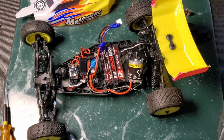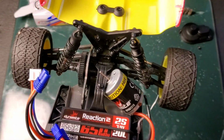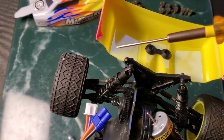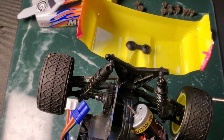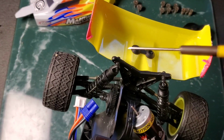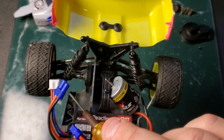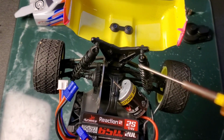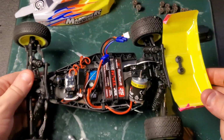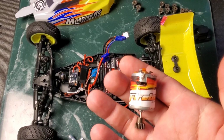So the other treat for today is that I don't plan any changes, except I might move the shock towers from the inside hole to the outside hole to give the rear more support. We noticed that in the previous videos it was pushing on power, and I think if I stand the shock up to the outside hole and leave the bottom on the inside hole, that'll give the rear enough support that it doesn't push too much on power. So that is a proposed change. We'll see how today goes. Today's going to be more power, and then in the video we'll see how it makes out.